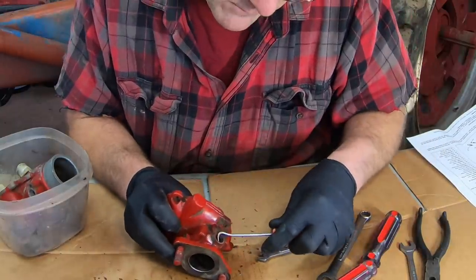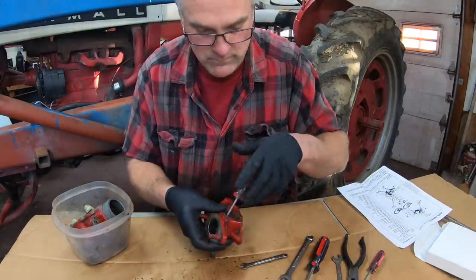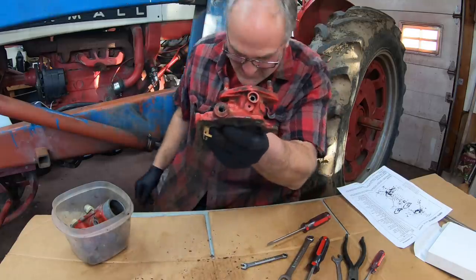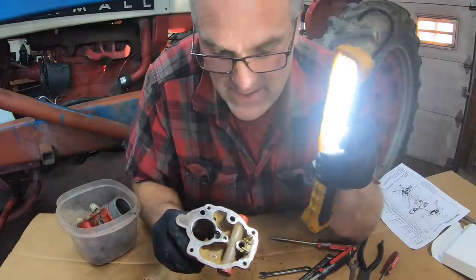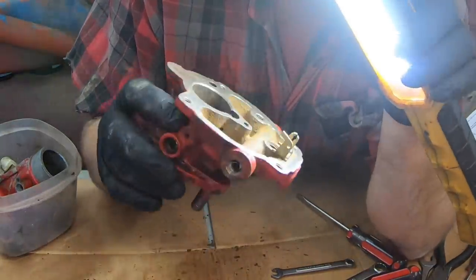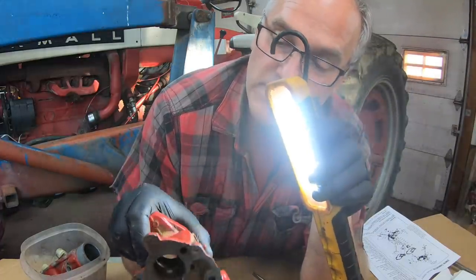Same as the choke shaft — I've got a seal on this end of the shaft, and then a plug on the other side. Just like on the choke shaft, you've got a seal on one side and a plug on the other. There's only one thing left on this top piece, and that's this piece of brass right down in here — I believe this has to do with the idle jet, it may be the idle jet itself. I don't have a replacement, and somebody's been in here before and partially stripped it. Better to let that dog lie — I'm going to leave that in there and blow it out real good before we reassemble everything. Now the carburetor is ready to go in the dip.